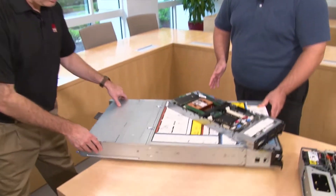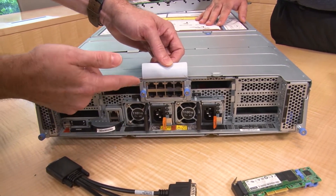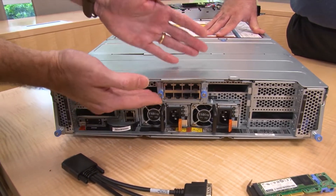There are a couple of things missing from this node that you'd normally see in a server — the LOM (LAN on motherboard) and PCIe slots. What we've done is completely disaggregated the IO and PCIe from the node itself and moved it to another part of the server. All those connections are at the back of the enclosure. This here is the External IO Module, the EIOM, which provides eight 10-gigabit Ethernet connections — two going directly to each of the four nodes. The EIOM is available in RJ45 10GBase-T or SFP+ cages for optical connections, or you don't have to populate it at all. Disaggregating the IO gives us a swappable module at the back with added flexibility.